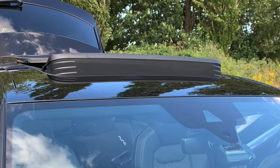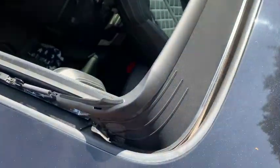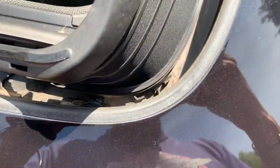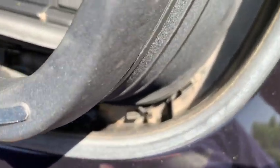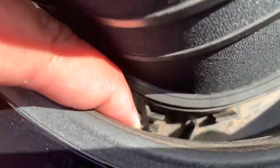The first thing you want to do is open the sunroof. Once it is open, you're just going to push this little flap thing down, and you're going to see on either side from the front there's going to be two little holes. You're going to get a soapy water solution that's on the warmer side.